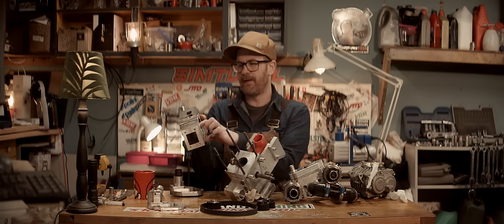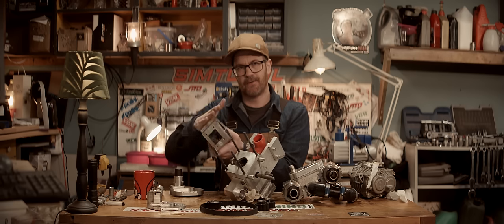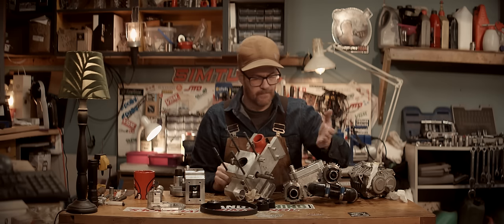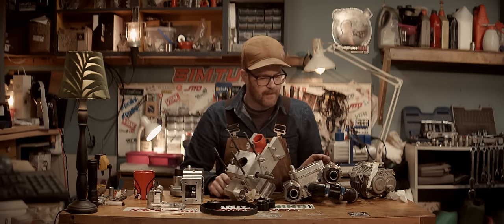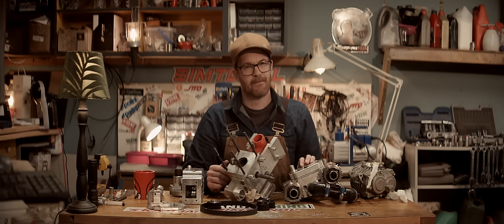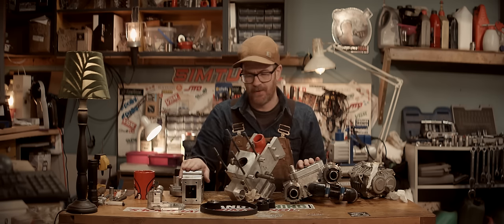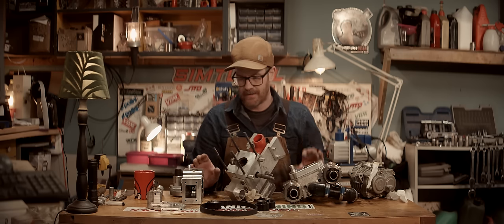And then with the reed valve design, hopefully be able to build even more pressure after the rotary exhaust valve closes, before the transfers close - because they're higher and there's more area. For getting results - getting something working and making more power than what you've seen from 50cc so far - I think this is the approach, without like tens and tens of iterations of pretty conventional two-stroke design. I think this is the approach.